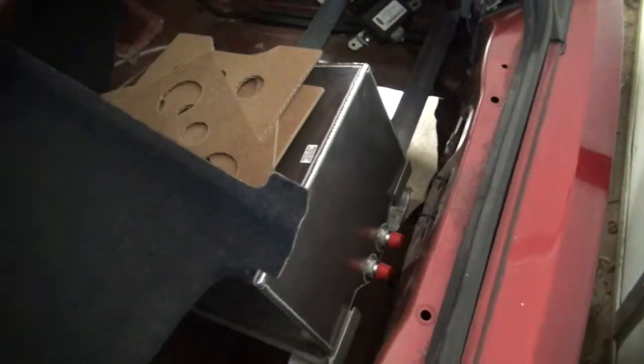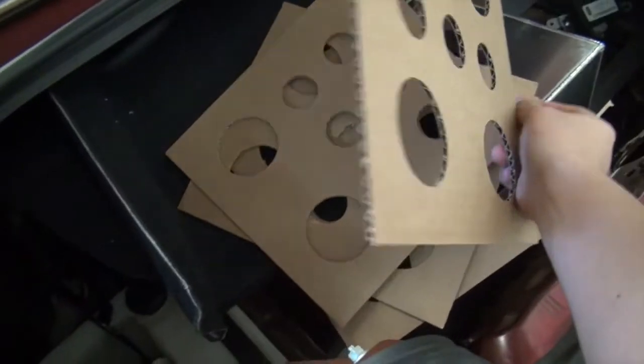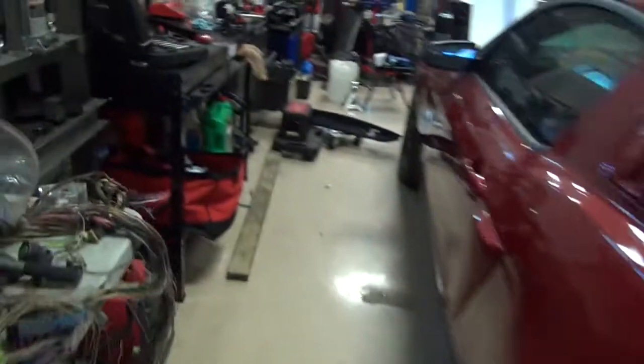I also started — you can't really see but I cut out the bottom of the car and I'm starting my mounts for the fuel cell. The fuel cell is gonna sit down and I'm gonna put a metal cover over it. These are some practice cuts of the fuel cell mounts, but I'm actually gonna make them smaller — no need for 11 inches wide. I'll probably go about half that, with one on each end to hold the steel cell in place.